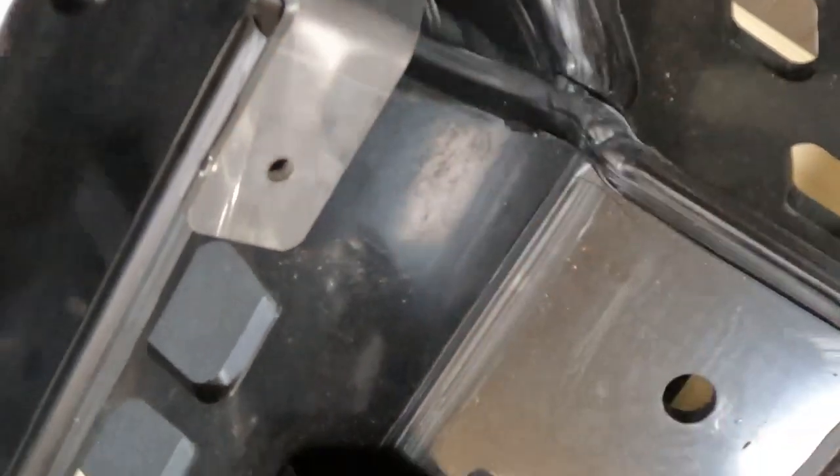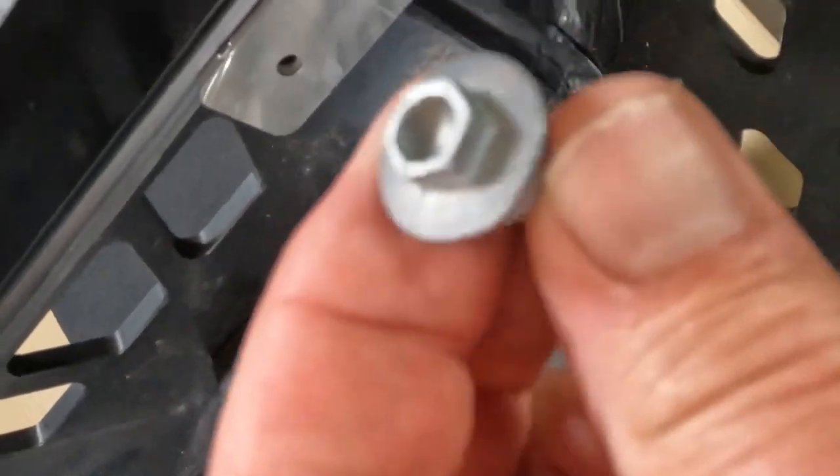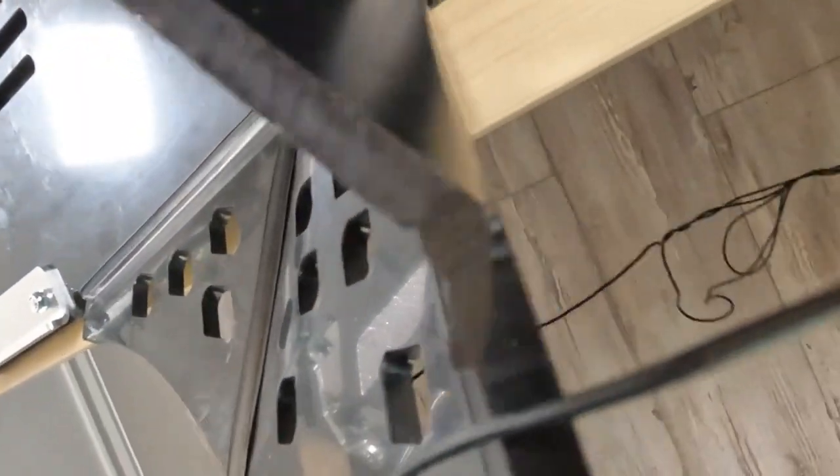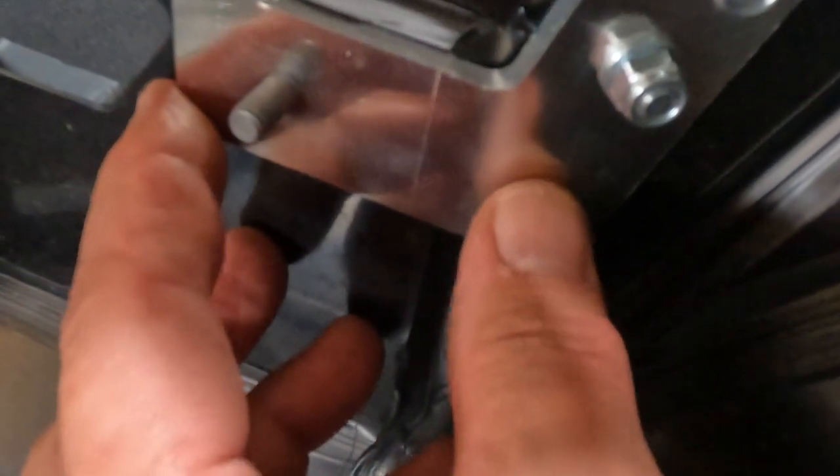So I've put all the metal work on. We've got the brackets here — these are the holes and the brackets that use the bolt on the bike. We've got the two brackets on and the strengthening plates here. Now I saw this on Rottweiler Performance — you take one of the screws that goes into the frame and you actually put it through the hole here. As you can see it's actually got a bit of a shoulder on it, so you fit it into there like that. And then you keep it in that side when doing these bolts up and it acts like a template to make sure that the brace is in the correct place.